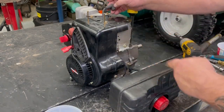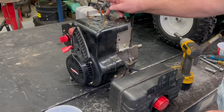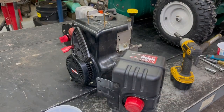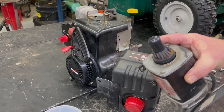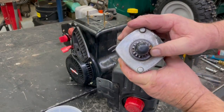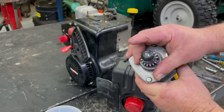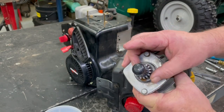That tight spot on each revolution — that's without a spark plug, so it's not the compression. In case someone thinks the compression is high on it or something, that's without the spark plug in it. That's what it did to the starter. They wanted me to put a new starter on it, but if you put a new starter on it, it's going to break all the teeth off it anyway.